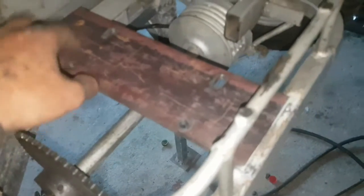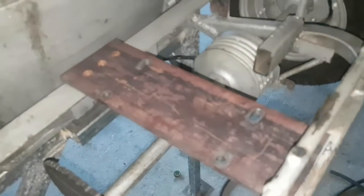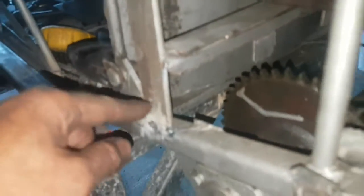So cool, I've just finished tacking together the engine mount plate. So this is solid, it's like 10mm. I've got adjustability in my mounts here and in the motor, but it's just supported here by these little frame pieces. I'm just going to load it up with welds. It's just tacked until I know that it fits. I'll drill these and put a couple bolts in when I determine my final adjustment, my final spot, because it's just tacked as well, so I'll move this. But it seems like a good solid system.